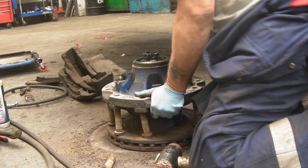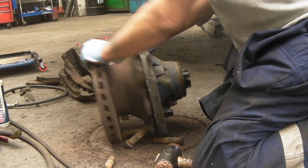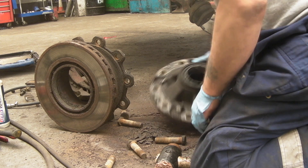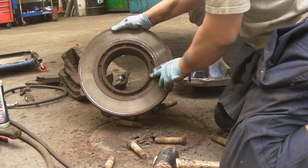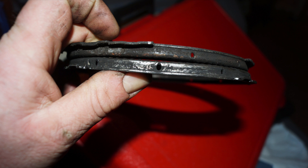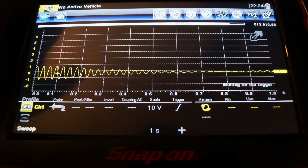After permission granted by the operator of the trailer, I can go ahead and change the disc because the ring is bolted into the disc. However, it's seized solid, so I won't be able to change it without ruining the disc. Another type of exciter ring is a tin type, and you'll find these on some cars as well. This one has got a dent in it — you can see that very clearly. This came up with an EBS fault — well, it's ABS because it's a pole and exciter. The EBS threw a warning light up in the cab. You can see spinning this at one meter per second, you've got a good signal of about two volts, and then it drops to almost nothing at all — that's where the dent is. A very quick visual way of seeing it.